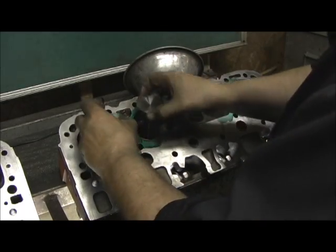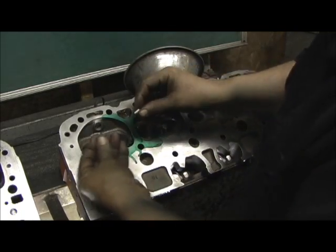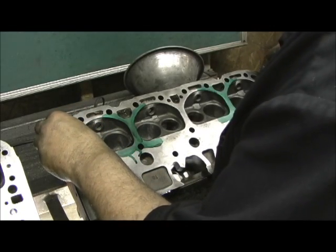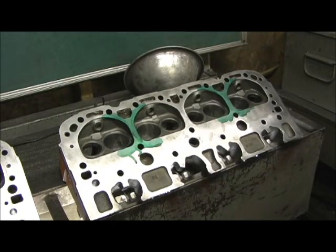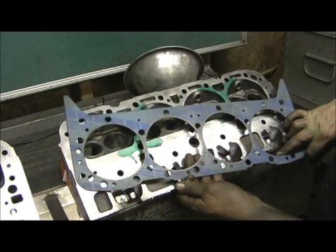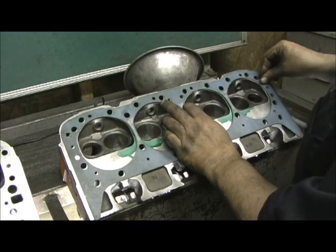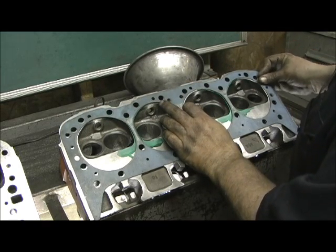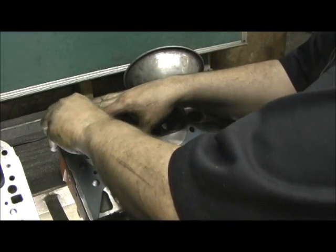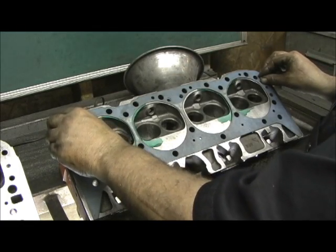Let's slide the valves out, and this is the correct way that you do it. First thing we're going to do is take dowel pins to lock the gasket on. We're going to put one in here and one in there. Or you can put them in the gasket — sometimes in holes, not that they're loose, but they're not exactly crushed. There's our blue stripe Felpro gasket. Turn it that side up — that's how it would be on the block. Then we slide the dowel pin in through the gasket and in the hole. Funny how one side's got a triangle in it and the other one's got a little circle the dowel pin goes to — that's probably to tighten them up.